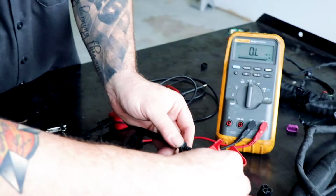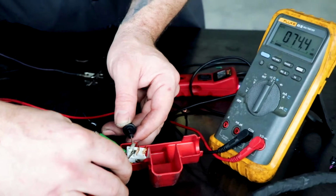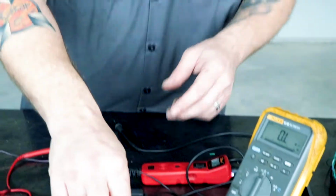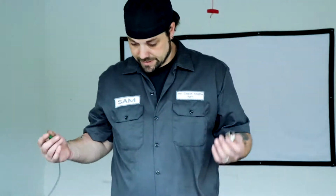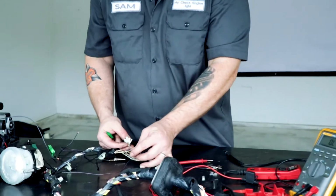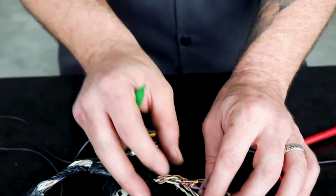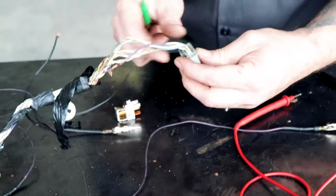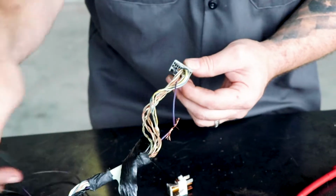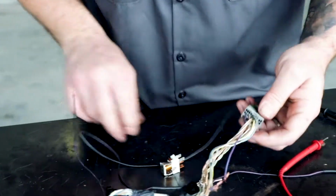All right, let's take a look here. So we have 74.5 ohms. That's pretty decent resistance. That's definitely well above the 5 ohms that they tell us is not going to be good, right? So let's put this into our circuit, again, with a single strand of wire. Let's put that into the circuit and see what we get with now 74.5 ohms of resistance plus 0.3, so just under. And that goes in there.